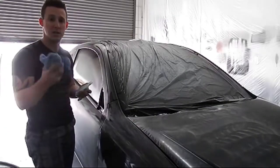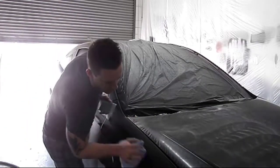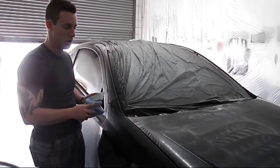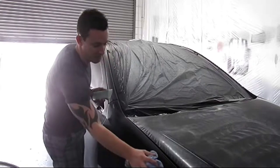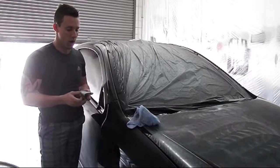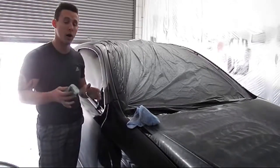All right, I've wiped it off and it's just super flat. That's 95% orange peel removed — very little spots where it still has orange peel. What we'll do is once we've hit the entire car, we'll grab some 1000 grit sandpaper and go around looking for spots where we can still see orange peel.